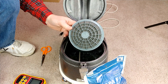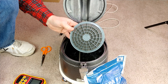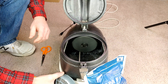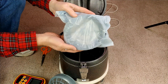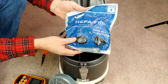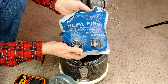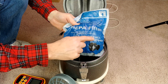When I refurbed my two TriStars I had two of these foam filters, and one of them literally disintegrated in the process of cleaning it. This one's in okay shape, but it's about five bucks. For one dollar more I found on eBay this HEPA pre-motor filter — it's got all the right markings and it was six dollars US. It removes 99.97% of airborne particles at 0.3 microns.